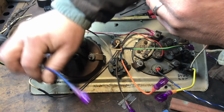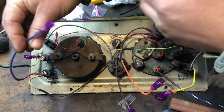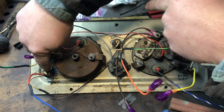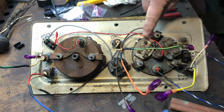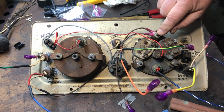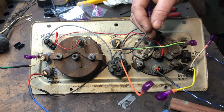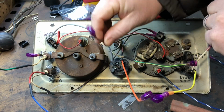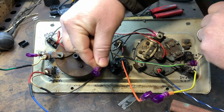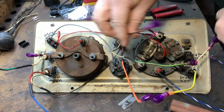Down here, we have our glow plug light, and we'll be talking about wiring that up in another video. But the glow plug light comes in here with a positive, lights up the dash, and I have this coming over to the ground spot right here. So as the ground location, I put this. Then from here, I have a ground wire, which is going to go over to a grounding block that you've seen in the other videos. So this is going to ground the whole assembly right to a good ground.